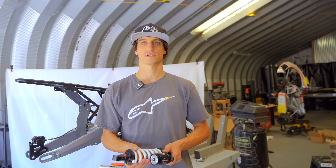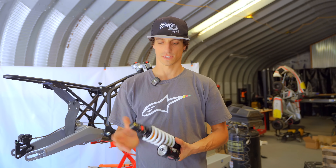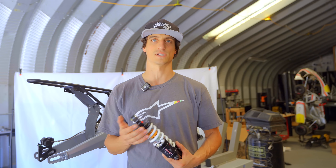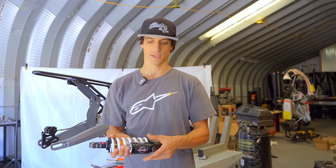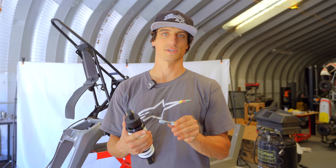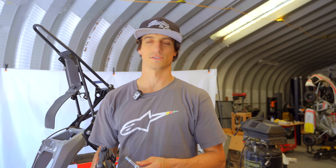To go with our new front forks, we also have this new rear shock from DNM. This is the race version of our resi shock, available now. It has a 450 pound per inch spring installed — might go to 400 depending on how it feels with these forks; that's something we'll figure out in testing. These shocks drop the back end of the bike just a little bit for more stability at speed, which I like for racing. The reservoir on the shock is always a good thing — it helps with cooling and oil flow. Another important tip, especially on a new bike or one you've just disassembled: always grease your pivot points — shock bolts, axles, swing arm pivot, anything that something's pivoting on or sliding through. Always grease it; it'll be a lot easier to disassemble later.